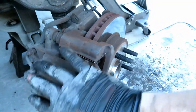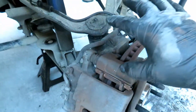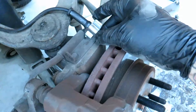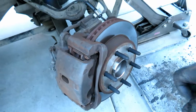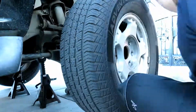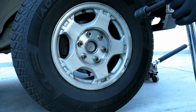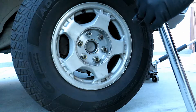Now go ahead and go over everything once — make sure all your bolts are torqued, point them out just so you can remember that you touched everything. Make sure there's going to be no binding, no tears or anything like that, and that everything is routed correctly. Put the wheel on and we're all good to go. With the jack still holding the truck up but some weight on the wheel, we're going to torque it down to 140 foot-pounds.